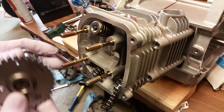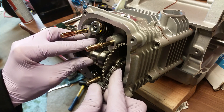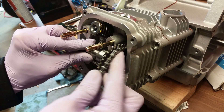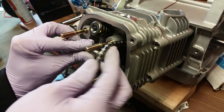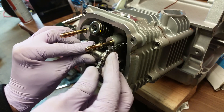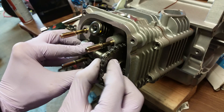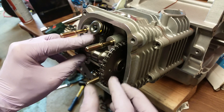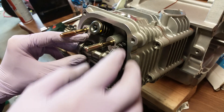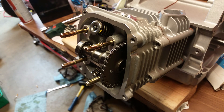Now this is going to be hard to do without getting in the way of the camera. Remember: keep your big dot up at the top. You're going to dip your camshaft down a little bit to feed it over — boom, just like that. That's how you do it. You dip it down, make sure you're in your chain guides, and then get the rocker cradle mounted.